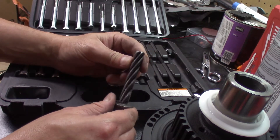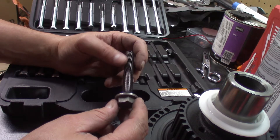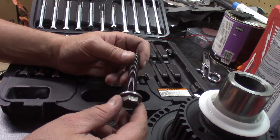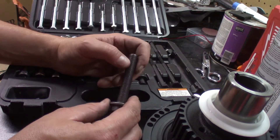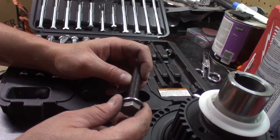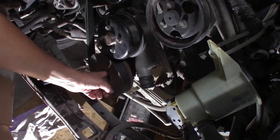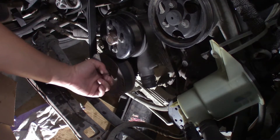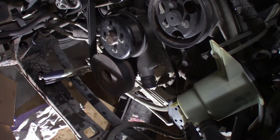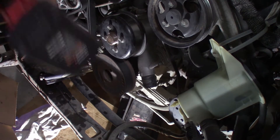It's a six-dollar piece — makes you feel better at the end of the day. You could reuse it; I'm sure it would hold, but why chance it? So we'll get back over to the car, remove the existing bolt, hook up this kit, and pull off that balancer. To remove the crank bolt, you can use a three-quarter inch socket or a 19 millimeter — both work. You can use a pry bar, or do what I'm doing and just use an impact gun. Just make sure everything's tight to hold the crank.